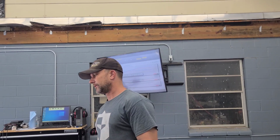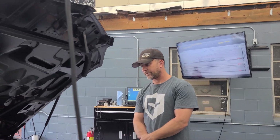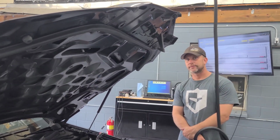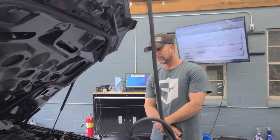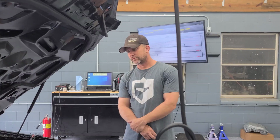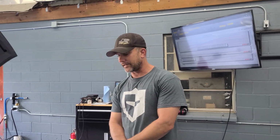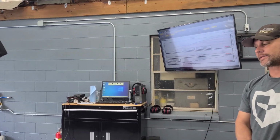it's getting close. I believe so too. It's really close with that, meaning the boost, but here's the other part of it. The boost is still increasing. That's right. We turn it to 7,000 and it's about 14 pounds of boost, which I'm not sure. Do they really use a boost number or is it more just CFM? It's CFM. Okay. It's impeller RPM. So if you spin that sucker on a four cylinder, it's going to make more boost. For sure. That's the number you're going after.